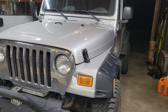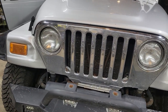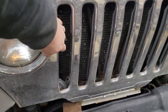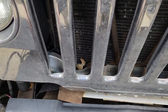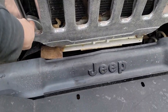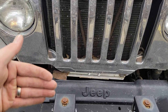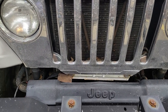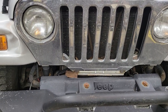Doing a little work on this to try and fix it up. This is my daily driver these days. If you saw the previous video, the grille was all bent up. I took that apart, took this chrome facade off, straightened it up, got back in here and straightened up the actual grille. For the bumper, I got a little ratchet strap and hooked it in a couple of different places, went across and back and forth three or four times, spent about an hour and just pulled the whole thing out. And if you overdo it a little bit, that's okay — it's easy enough to push it back with a dead blow hammer or soft face hammer so you don't scratch all the paint off. Turned out pretty good.